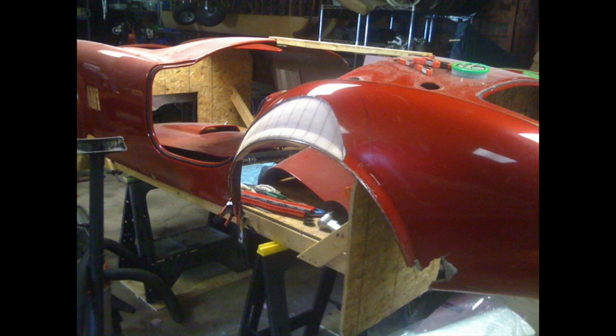What I did is I drew some lines vertically on the right-hand quarter panel from top to bottom at 2-inch intervals, and then took a profiling tool, which you can see laying on the plywood platform. It's that red thing with the black stripe down the middle. It's a number of fingers that are strapped together, which you can push against any surface, and the fingers will take the shape of that surface. And then at 2-inch intervals, I took the shape and transferred it to 2-inch thick pink builder's foam insulation, and then just stacked them all together and shaped it roughly with some coarse sandpaper, and then stuck it up on the inside of the fender well with hot glue. And it worked pretty well.